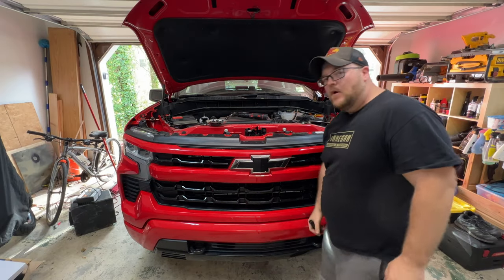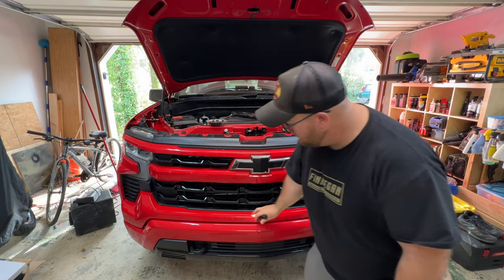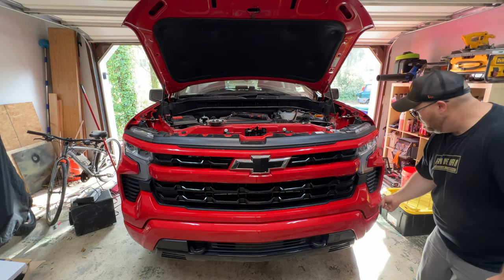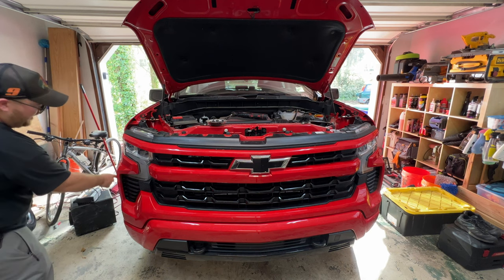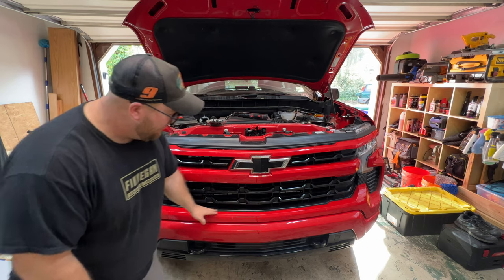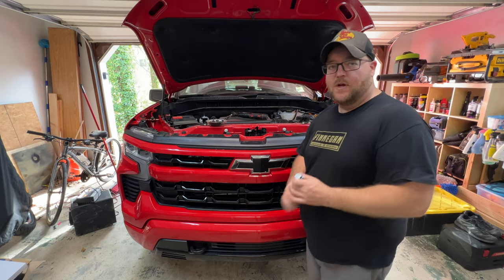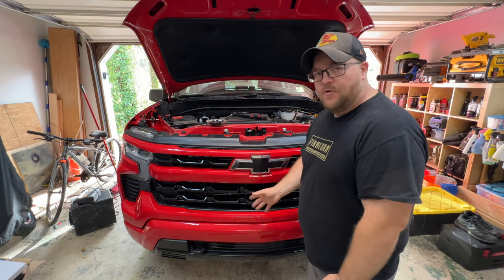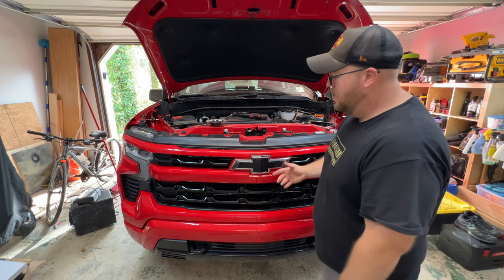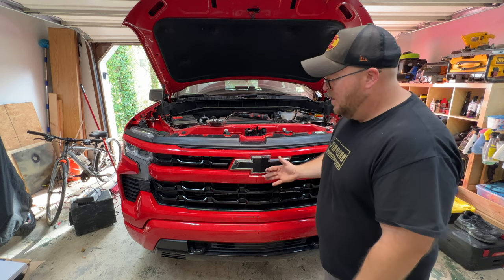The grill is getting kind of loose, but I'm learning that this front fascia piece here is connected to the bumper — I didn't think it was. So I'm going to have to loosen this whole panel across the bottom as well, because it looks like the grill and that panel are stuck together. One recommendation from a video on a 2500 truck: put a furniture pad out on the ground, because when this comes off it can drop, and the last thing you want is to chip up your nice grill on the concrete.